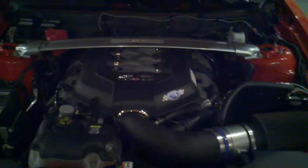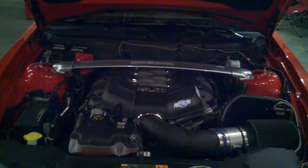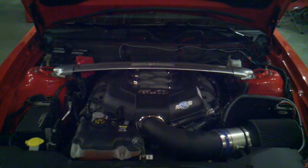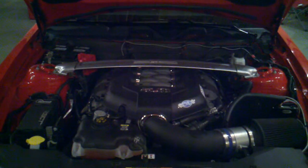I've been working on something for this car here, and from the front, unless you know exactly what you're looking for, you will not really be able to tell. I'm not real happy where I had to install the window switch, but as you can see, it sits right here. That is the Zex window switch, and I pretty much got most of the wires hidden down below it there. I need to clean it up a little bit still. That is used to set what gear I want the nitrous to engage, what RPM at wide open throttle, and also what RPM I want it to deactivate at.